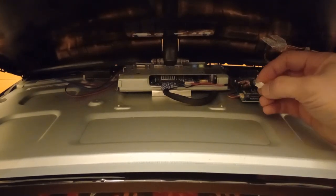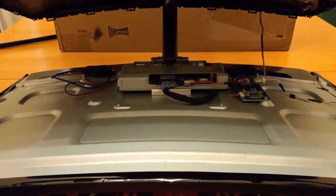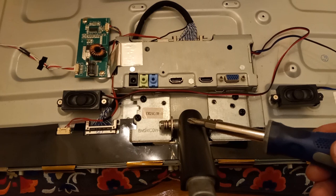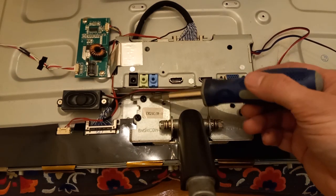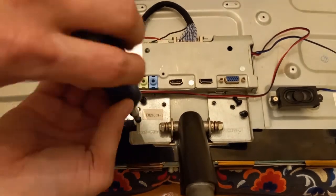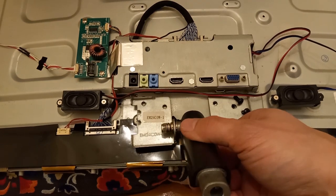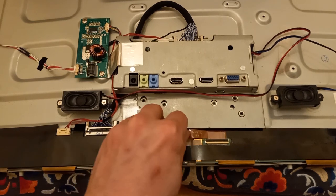There are little tabs on the side of the connector to grab with your fingernails or a tool. Once the cable is unplugged, you can just lift the back panel up and off. Now we're ready to remove the stock stand — your screws will probably look different, but the kit comes with replacements. With the screws off, you can just lift the stand up and away. Don't leave extra screws in there.